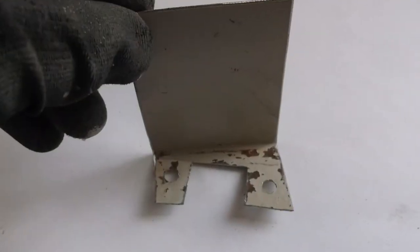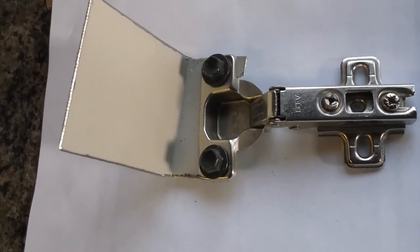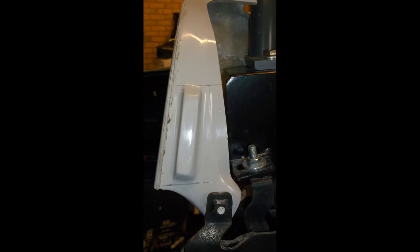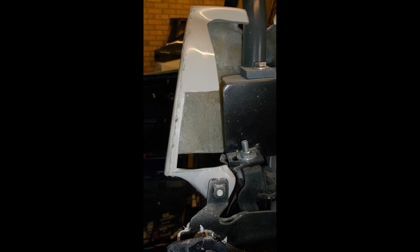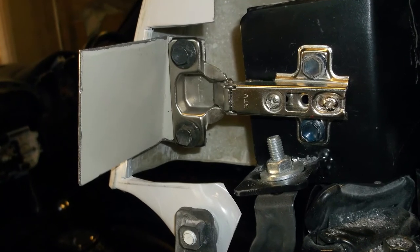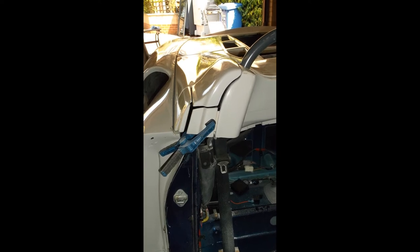To make this work, firstly we need to make a bracket that looks like this. We then mount that bracket onto a standard cabin hinge. You will then need to cut out a little piece of the roll bar surround right at the end, as shown here — the pencil marks indicate the area to be cut out. We can then drill some holes and mount the cabin hinge, then bond the Z-flap onto the plate, using a clamp to keep it aligned while the bond dries.